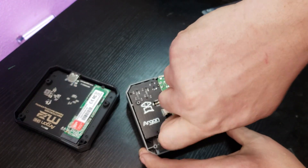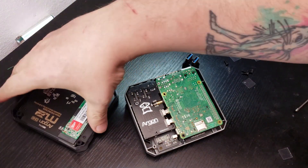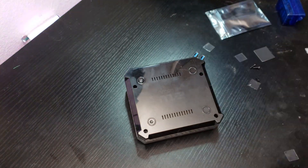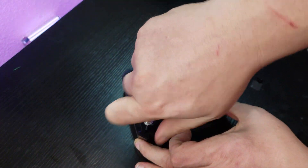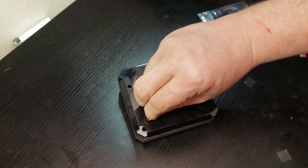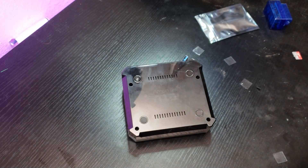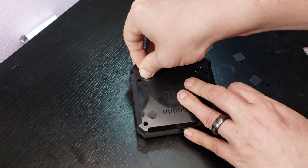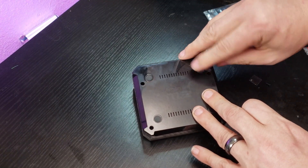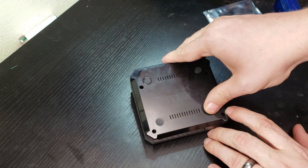There is one top screw that I didn't put in, but we don't need it. At this point we can go ahead and put the bottom of the case on — it just sits in place. We'll put some screws in and then connect the USB 3 bridge that connects the SSD to the Raspberry Pi. It does come with four little feet — I encourage you to put those on because it helps keep things in place, sticks to your surface better, and keeps you from scratching anything it's resting on. Then we'll go ahead and put that USB 3 bridge in to connect the SSD to the Raspberry Pi.